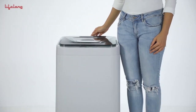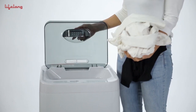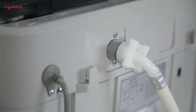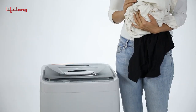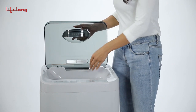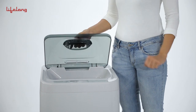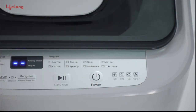How to use: Once the machine is set up properly, add adequate detergent depending on the number of clothes. Connect the inlet pipe and turn on the tap. Before putting in the clothes, check pockets for coins and receipts. Press the program button and select a program according to your needs or the type of clothes.